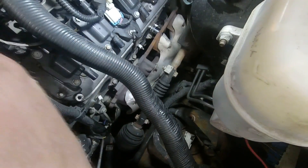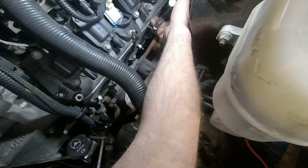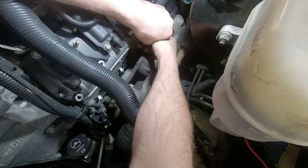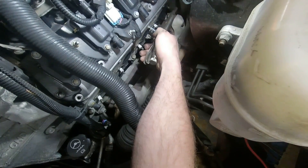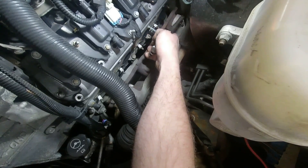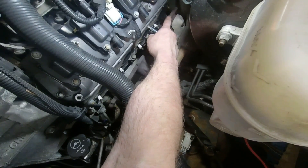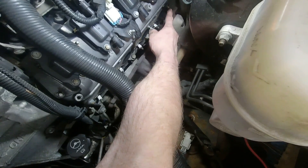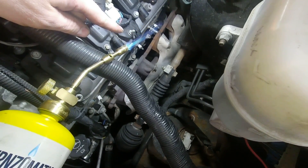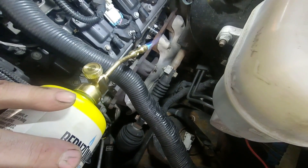Now we're going to try and grab that stud with a vice grip. I'm going to try and get it without getting all fancy, then I'll show you what to do if you do have to get fancy. This one is actually turning, so I can get it — but the big issue is loctite, so it keeps spinning. I might heat that with a torch to melt the loctite. I'm using a map gas torch with a more directed flame, but ideally an acetylene torch or inductive heater would be better.